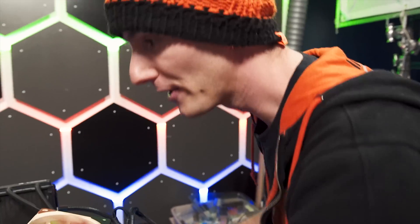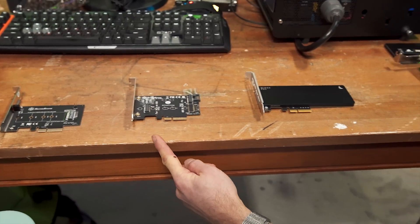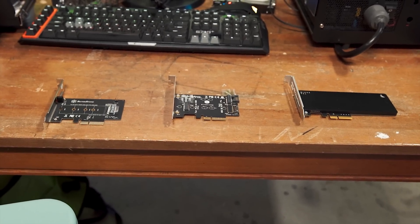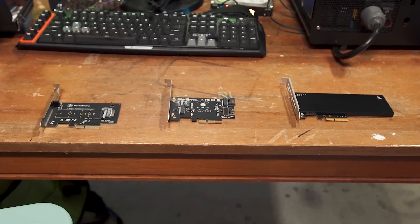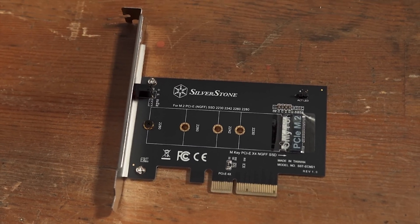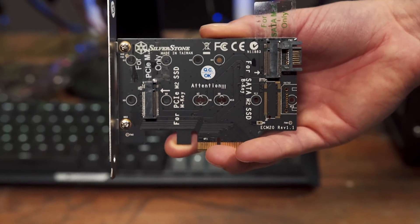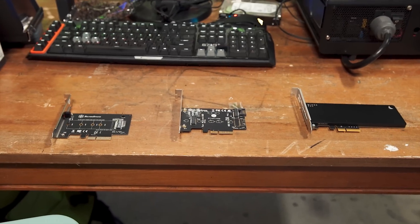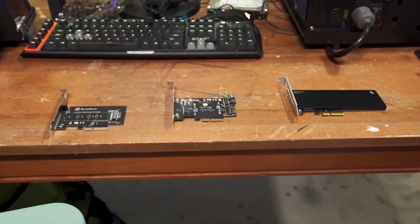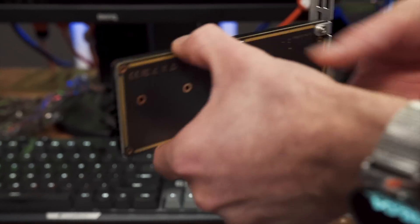And if it does support it and you still want to use a drive, then you want to pick up one of these little cards. These cards plug into a PCIe slot on your motherboard, just like a video card, sound card, etc. Consult your motherboard's manual to find out how many lanes each slot has and what speeds they operate at — more is better. Silverstone has an NVMe-only one, and one that supports both NVMe and AHCI. There are also more premium options, like the wings from Angelbird that look a little cooler and include a thermal shield and pad to keep the drive from overheating.